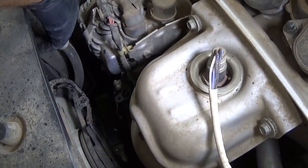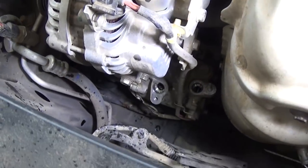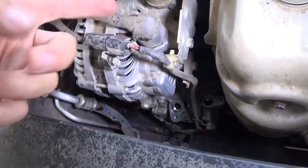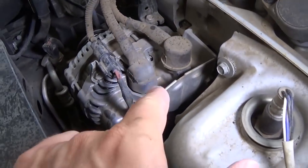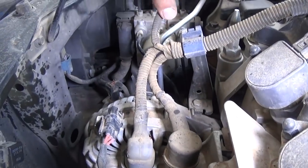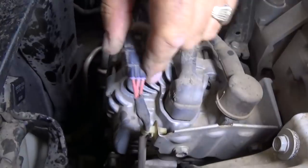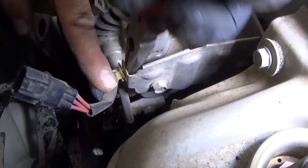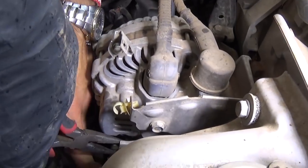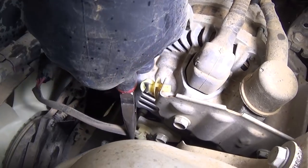So we have the hoses off and the belt is off — we're accomplishing quite a bit so far. Unfortunately the AC compressor needs to come out from the top, but the alternator is in the way. So we'll just remove the alternator to the point that we can flip it on top of the engine — we won't need to disconnect the whole thing. Now we need to remove this wire here for the AC compressor. You squeeze there with pliers to take that clip off. Sometimes they break, so you can use a zip tie to replace them — from the heat, that plastic is really fragile and tends to break.